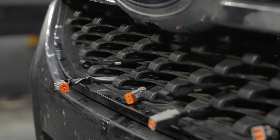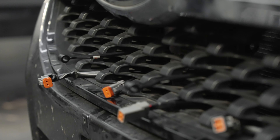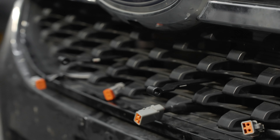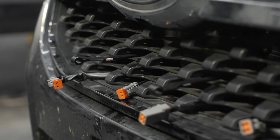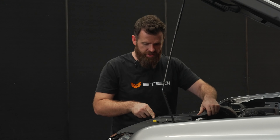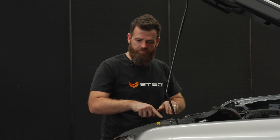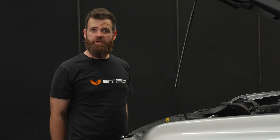Now that the grille is on and we've sent the camera wire and the water line through — if you're running a set of lights on the rally bar, it's best to send the driving light wiring harness through too. We have a video on that and instructions on our help center. Thread this top plate back underneath the air intake, line everything up, pop it back in, place all the clips back in place, and we'll jump around the front to install the rally bar.